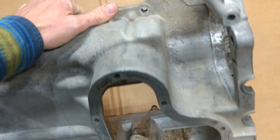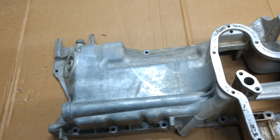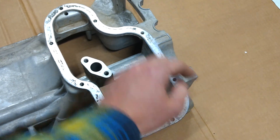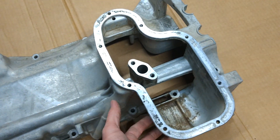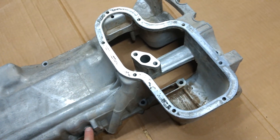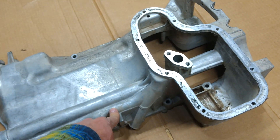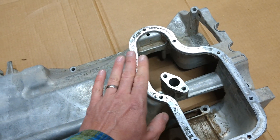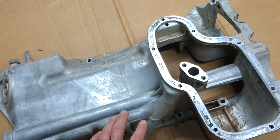Going front sump — talking it through with Greg and the way we would probably do it again — is cut off your stock rear sump area here. Greg had done this when he modified a stock pan originally, essentially what he did. Cut off this huge sump area, plate that as slim as you can. This is probably too tall for our mounts or it's going to be very close — you might need a spacer to get it up higher. When we made our mounts we were trying to get as low as possible, and it left about an inch and a half of clearance between the oil pan and the crossmember.